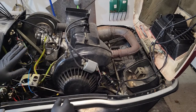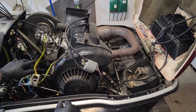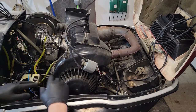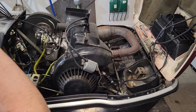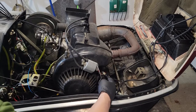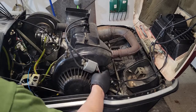The stator goes in the exact same spot. The CDI mounts the same - you just have to set the timing on the stator. The wiring harness is set up a little bit differently since the sleds are dimensionally a bit different where the wires end up. On the stator side it just plugs directly in - all those match, and the ignition coil plugs in the same way.